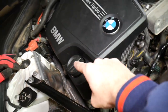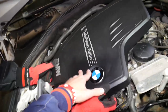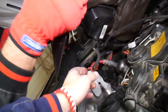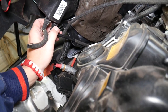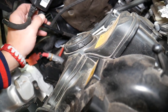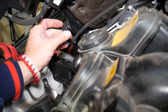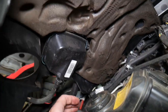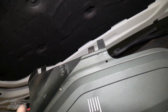When you lift it up, you're going to have another vacuum line that you have to be extremely careful with. Grab it gently and slide it out. This is the vacuum line you need to disconnect underneath — push in here and disconnect. You can see there are two spots to press in, one on each side. Squeeze in and pull it out. Then you can simply pull the cover out.